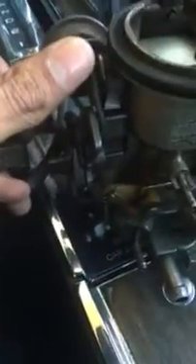What you do is you can just literally tap the throttle and that choke plate will just open up. So if you do a cold start on this carburetor and you see the RPMs shooting up, you have to tap that throttle as soon as possible. Because the engine's cold, you'll just end up screwing something up.